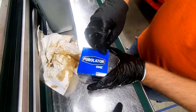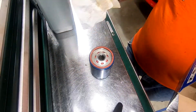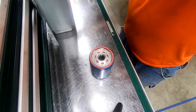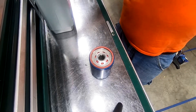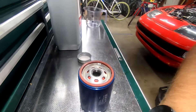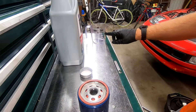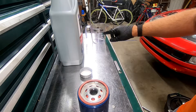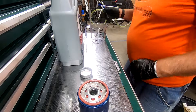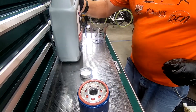Now we're going to take the new PureOne filter — nothing fancy, similar size, decent brand as far as I know. What we're going to do is load the oil filter up first so it doesn't go in dry, and we're going to get the seal damp. This is 3.4 liters total, so I need six 500ml measures plus 400ml extra. I'll poke a hole on top of the oil jug, put a little drain on the backside, and load this filter up using my measuring cup.